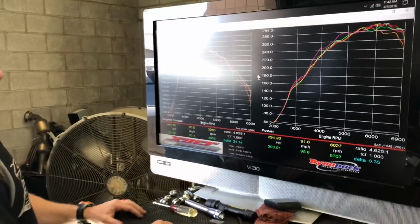It's awesome. All right guys, so we did 4 baseline runs, and something that I learned with these baseline runs is that this car gets hot really quick. This is already pretty well known. People were taking it on the track, including myself. You do 1 or 2 laps, and the car is hot. As Tim explained, the intercooler is a really big restricting point for cooling.